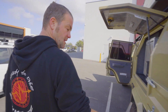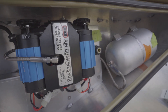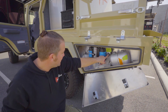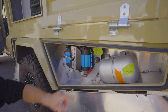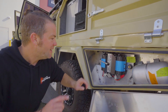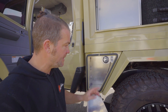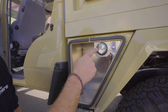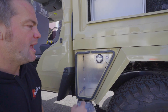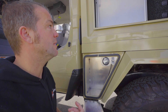On this side we put in a compressor — the usual ARB twin-piston compressor. This still needs to be finished off as OnTrack Fabrication still needs to do some work, which is why it's not bolted in yet. In the future you'll be able to plug in your hose here and switch the compressor on from here as well — at the moment it's not connected, which is why we put a 'do not run' sticker over it. This is for air. Over here we've got water — OnTrack Fabrication will still install the pump and do the plumbing. When you turn it on, you've also got a water gauge connected, so as soon as you power the pump the water gauge activates and you can see how much water you've got left in your tank. You'll then have a hose connector for pressurised water.